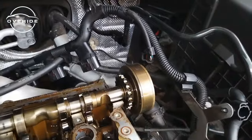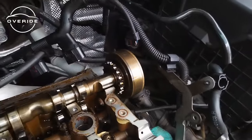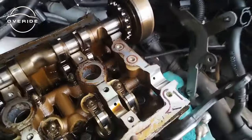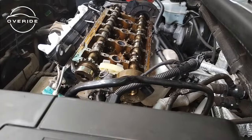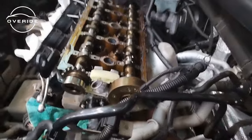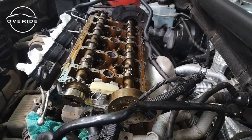I'm not sure how I can even record this for you, because I have to be holding the camshaft. I can't put it down because it will have some debris on it. I'll just try to put it on right here. The 18th and 19th link will have to go onto the cam variator. So I've put back the tensioner because the tensioner just goes straight in. It's an in and out thing. I stay next to a highway, guys, so I'm sorry for the noise that you are hearing.